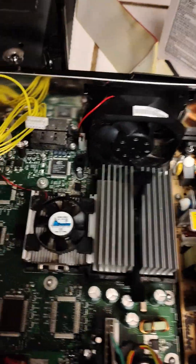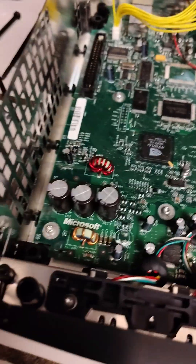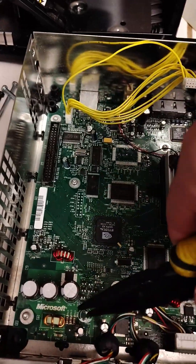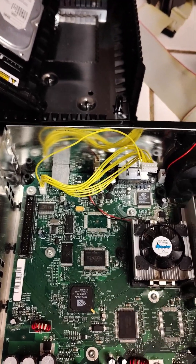You also want to make sure you inspect your board and look at your caps. None of the caps are bulging. You can see a little bit of dust there. I just removed the clock cap — that's where the clock cap would go. The easiest thing to do is grab a pair of pliers and yank it out. For a 1.1 to 1.4, always remove the clock cap. Just remove it.